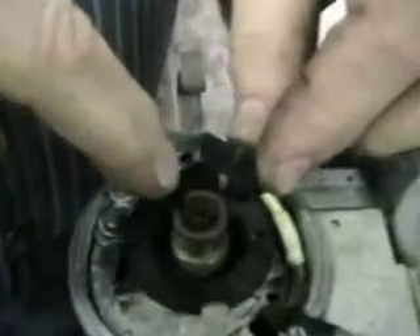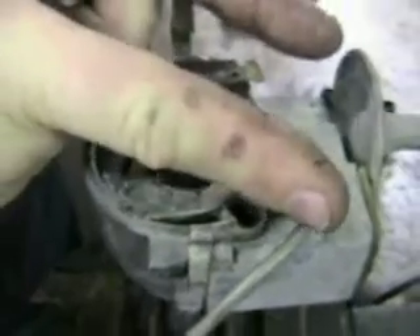Look at our pickup in the slot. The slot is way over here, so that means the slot has to go all the way to here before it breaks — and look at this: it's between the points on the underside of the cap. So the spark is going to have to jump, and when the vacuum advance works it might pull it even farther away. The car might run great at idle but then at higher speed it might start to run really poorly and you'll pull your hair out trying to figure out what's going on.